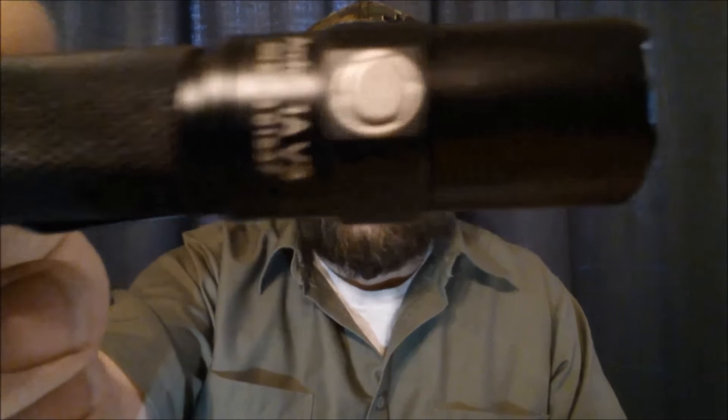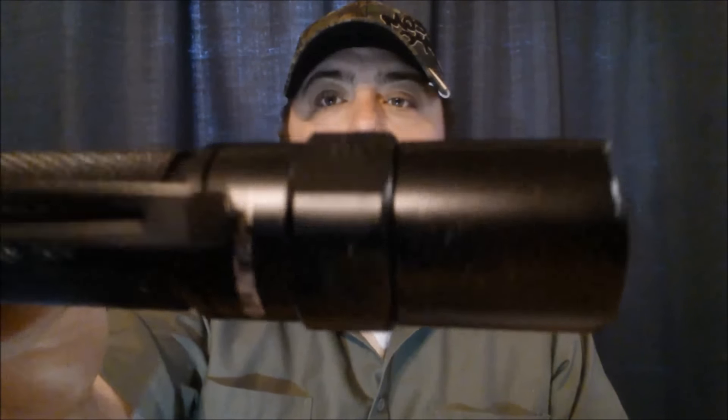There's a little better look at the flashlight. It does have a pocket clip on there, it does have the tail cap switch, and then the mode button up here. Now this flashlight will work with either a AA or a lithium ion 14500 rechargeable. And with that rechargeable battery, just by comparison, you're getting about two to two and a half times the lumen output on this little flashlight. So that is really cool for a flashlight this size.